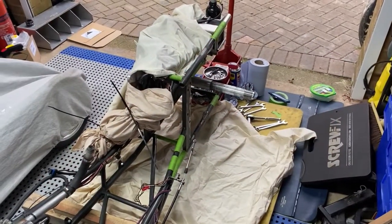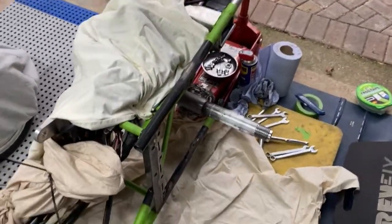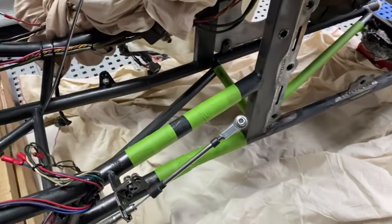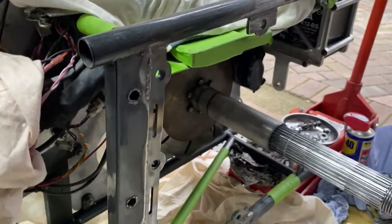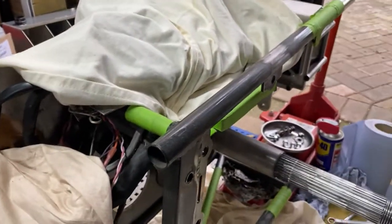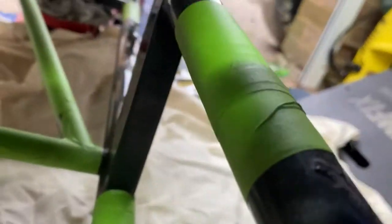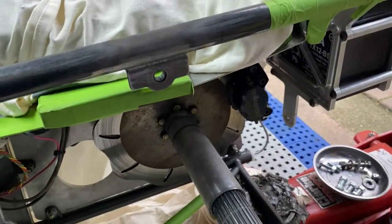Alright then guys, so we've just finished all of the prep work. Axles are all removed and I've done masking all around the chassis in certain spots where I feel like it needs attention, leaving the exposed areas that have been welded ready for paint. I've done my best to cover all the harness up and out of the way so I can get in all the areas around the welding. Let's get ready for the primer now — let's see how we get on.